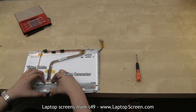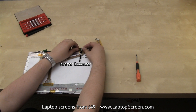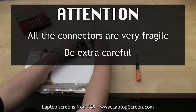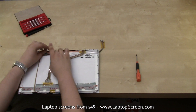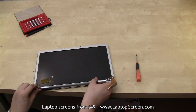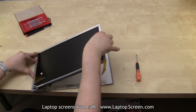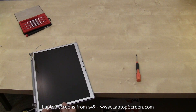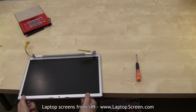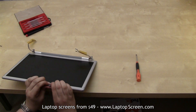Carefully reconnect the video cable and secure it with tape. Reconnect the backlight power. All the connectors are very fragile — be extra careful. Secure any and all other tape. Place the screen assembly in the top cover starting from the left edge, being mindful of any protruding cables. Squeeze firmly around the perimeter starting from the bottom edge. The tabs make a distinctive click when clicked in properly.